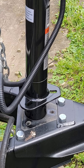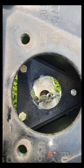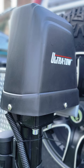When I first attempted the install, I found that the bottom hole that the jack slides through on the tongue was just a sliver too small and needed to be filed down a bit. After the jack was installed, I discovered that it did not have ample clearance for the liftgate on my 2022 Jeep Grand Cherokee L, so I removed the bolts on the housing with an Allen wrench and reversed the housing.